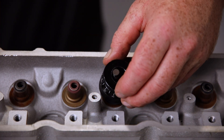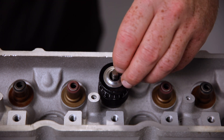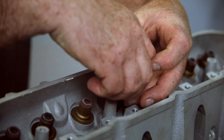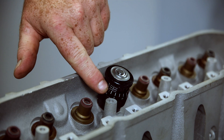The first and most preferred method we will show is performed using a valve spring height mic. With our valve seal installed, we can place our height mic over the valve stem, install the valve spring retainer and keepers. Now adjust the mic until it contacts both the retainer and valve seat. The reading on the mic scale will be the installed valve spring height.